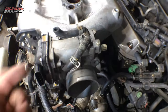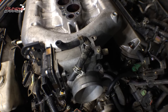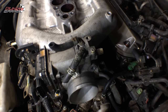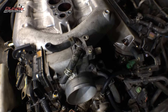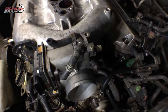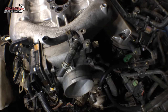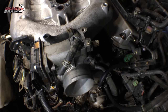I actually live here in Southern California — it doesn't get all that cold — so what I usually do is just take those lines out that send coolant to the throttle body. I understand why it's done in colder climates where it snows or in the rust belt: they want that throttle body to get nice and warm as quickly as possible in the OBD2 system to go into closed loop, so it's the most fuel efficient. Here in California it really doesn't make that much difference.